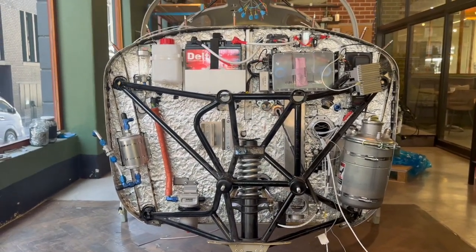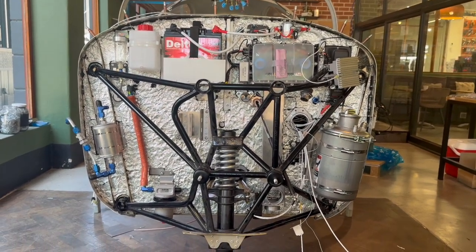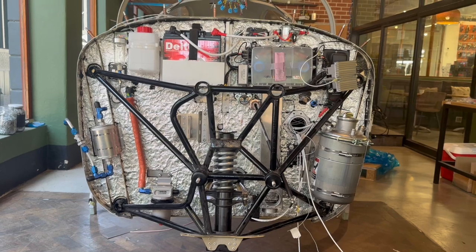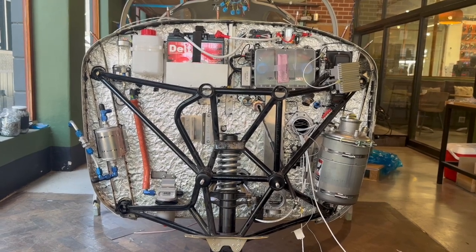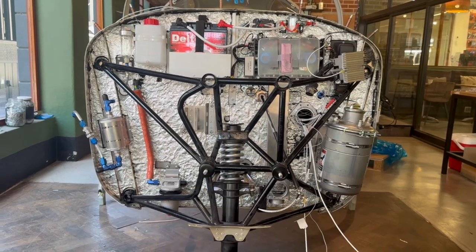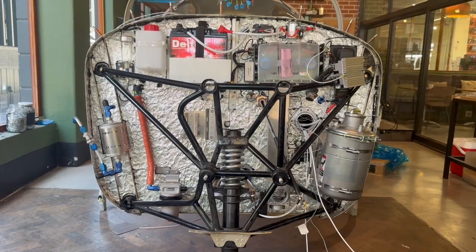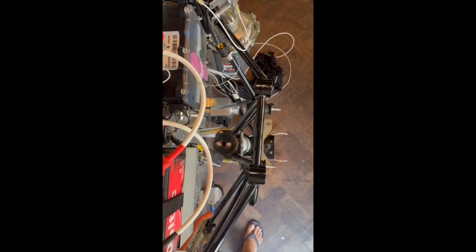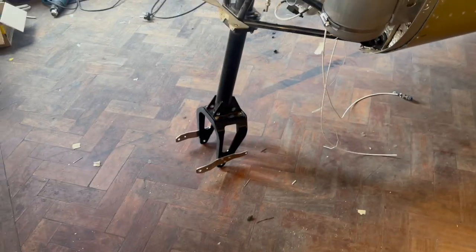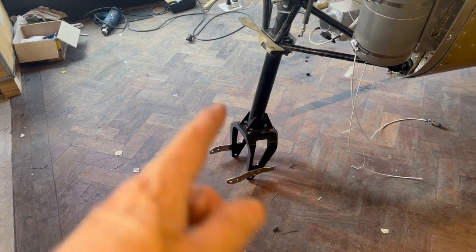Here's a quick little bit for my model aeroplane friends. We all know that in a model airplane you need to have some offset built into your engine for the thrust, for the propeller rotation - well, a big airplane's no different. You can see the engine mount here is definitely not centered and it's pointing off in exactly the same way as you'd expect a model airplane to be. Looking down from the top, you can see the thrust is off to the right.